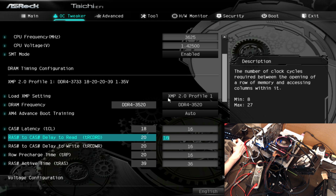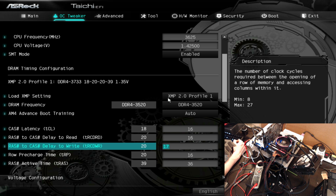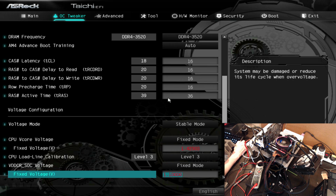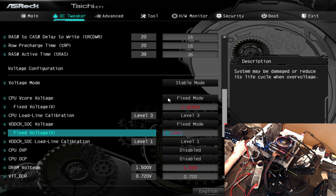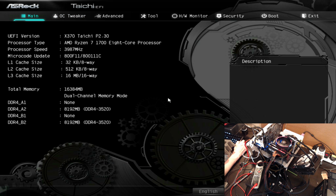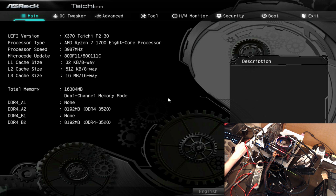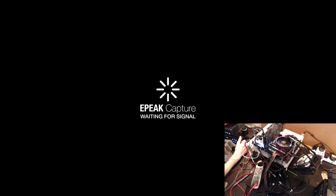So how do you fix that? You just go through every single one of the settings and refresh them. I know. And at this point, we're almost 4 gigahertz. So the CPU worked. And at this point, the memory should take, unless it throws an error again, and everything should be fine from here on out. Yeah, so now it's posting at full speed. And Windows is going to try to repair itself.